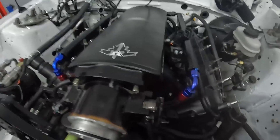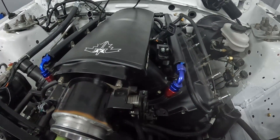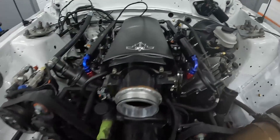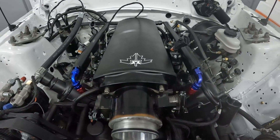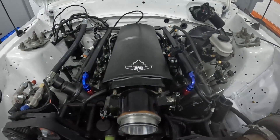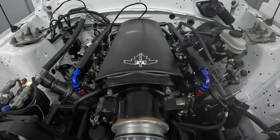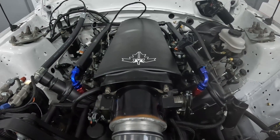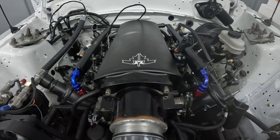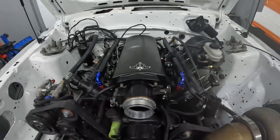Over to the rail — the line that connects the two rails at the front is a dash-6. That is definitely going to get changed to a dash-8 for springtime. The conundrum I'm in right now is I'm just spending money and spinning my tires, so I've kind of used things that I had. That dash-6 line is probably a no-go and it's going to get switched out to a dash-8.